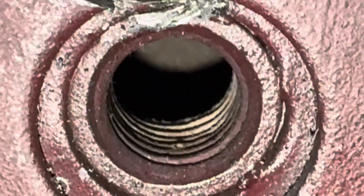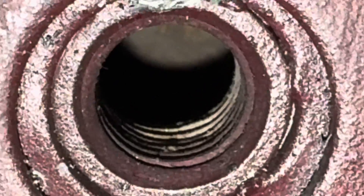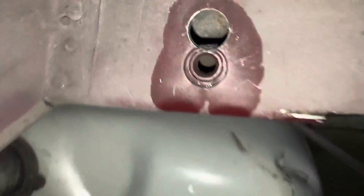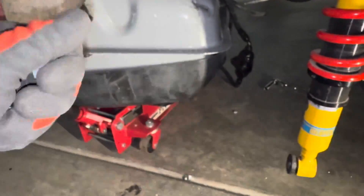Just to line up the bracket correctly to cut the bottom, I drill out where the quad shock bolts typically go. You can see there are three threaded holes that have been used, and then two or three back there that have never been used — they're a completely different color. What happens is the hole reduces in size, or gets more narrow — you could argue it's to kind of lock the bolt in place — but if you keep trying to thread a bolt in there it's going to strip it out. So what I did is drill another hole on top of it so I could use both mounting holes on the IRS bracket.